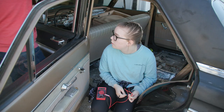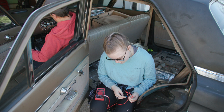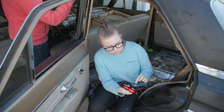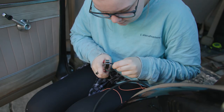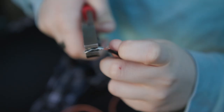Brake on. We're getting 12 volts, so we're getting good flow through there. It's working, but the movement of this actually matters - when I move it up and down it moves. Maybe we don't have a very good crimp here. A good amount of the wires are just out of there - broken and fraying. There's a good amount of the wires that are just out. Well, there's the problem.